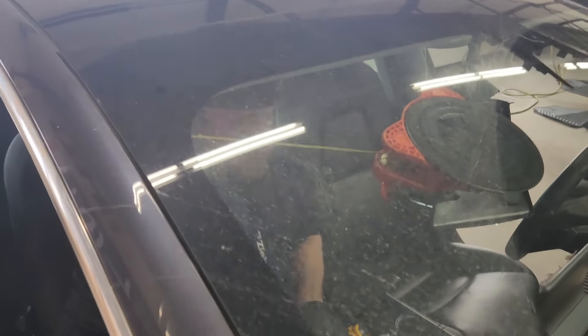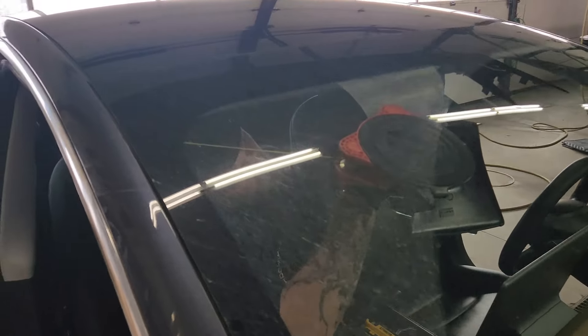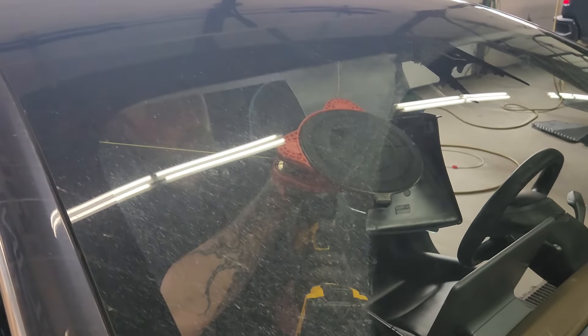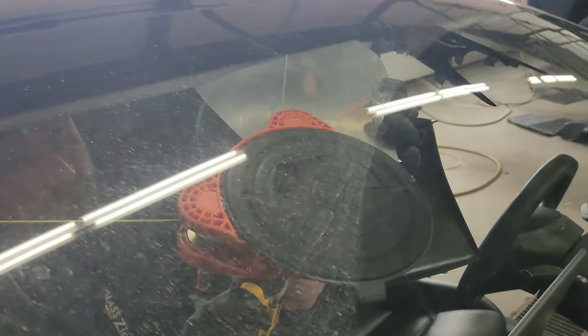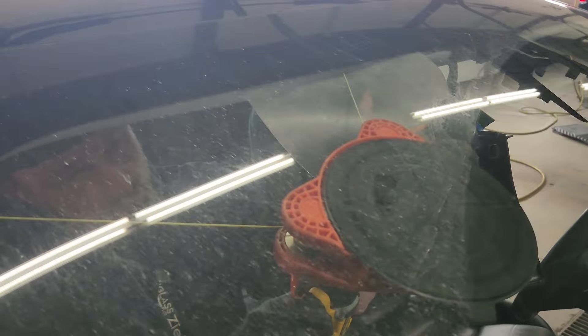When that's all you have, pulling glass out is easy. But then when you get the Tesla windows and they've got all of that, you catch on things. You're actually using a blue stick to try to avoid anything, because as you remember from the last video we did on a Tesla, all up in here and across there is wiring for the camera. You definitely do not want to damage that, because instead of making money on a windshield replacement, you'll be spending money. Nothing on these cars is cheap. So you use the blue stick and that plastic cover to avoid any damage.